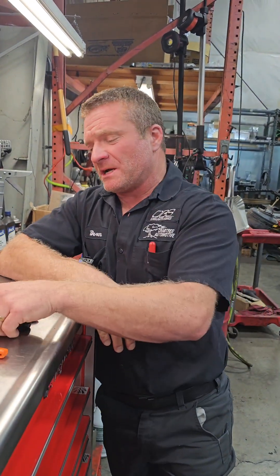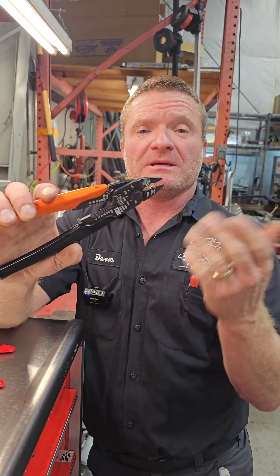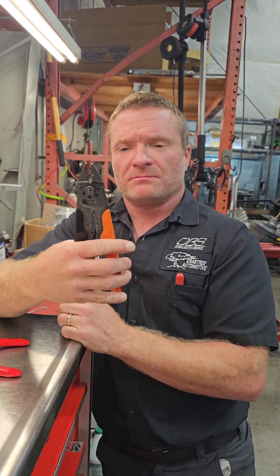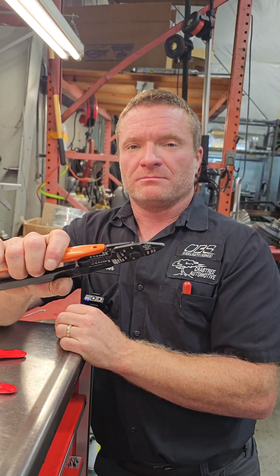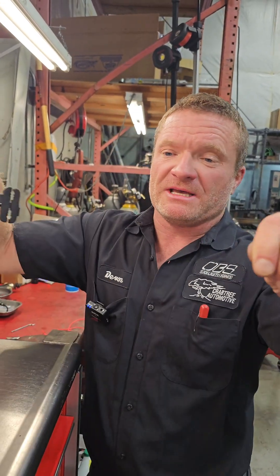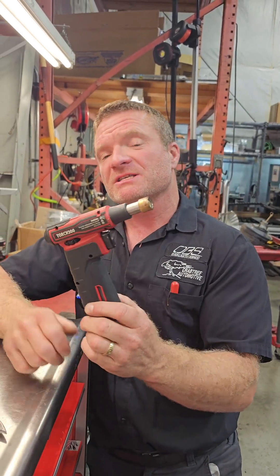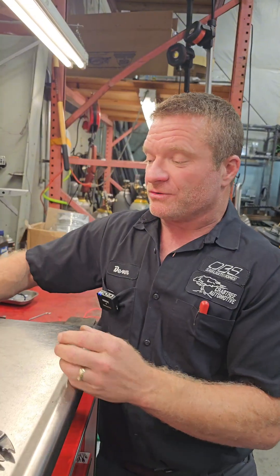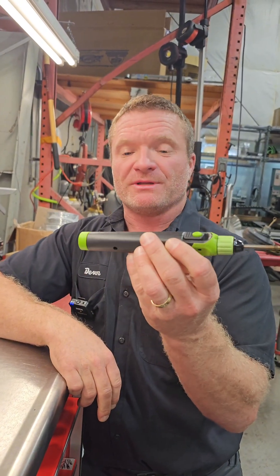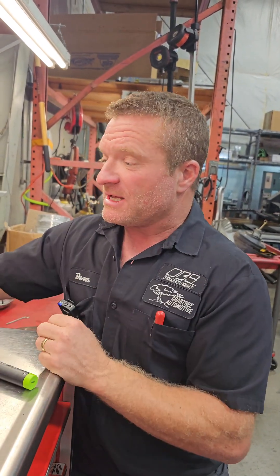All right, tools for the job - they're basic, people. We're not splitting atoms. A basic set of wire strippers - I like the combo set. You can use separate ones, but sometimes those are a pain when you're trying to strip a wire in a tight spot like under the dash. I like these guys here - you can use it horizontal, easy to get under the dash. I just like having one tool that does everything. I'm also going to use, because we're soldering, a torch. I only use this if there's obviously enough real estate. I will also use one of these guys, just a simple soldering iron. This is a bougie one that's electric - a simple plug-in one works really well to do the job. And for the shrink tubing, I will use a heat gun. Your wife's hair dryer will work on high if you really want. Or you can use a torch if you have some real estate to do the shrink tubing.